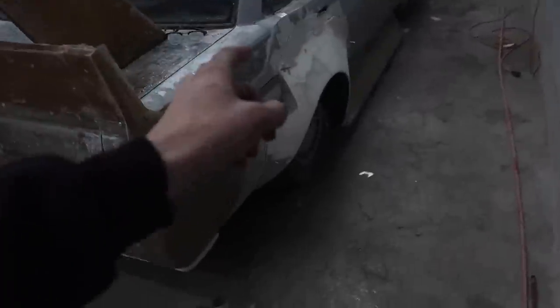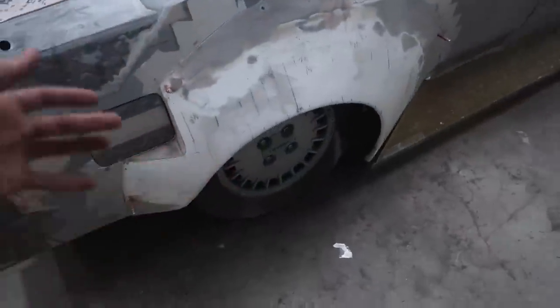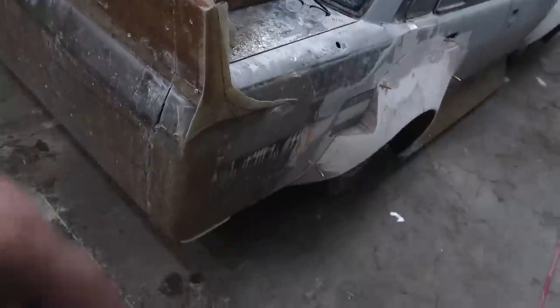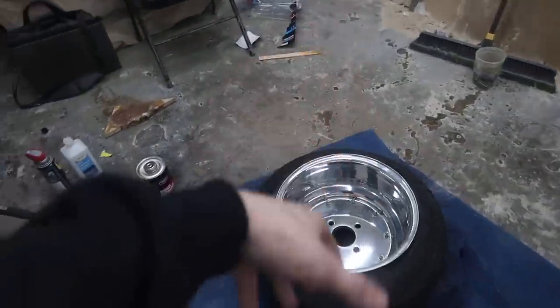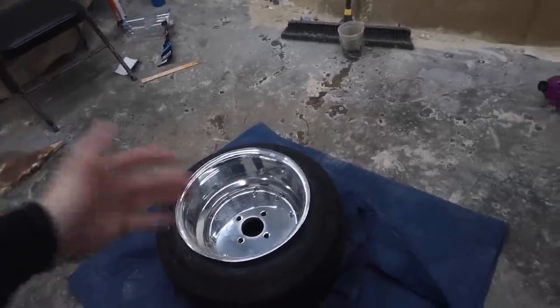We're gonna try and put it on the front and the rear, figure out what kind of spacer we're gonna need. The front's probably gonna be good because I'm gonna have a little bit more clearance because of the stretch. And in the rear, of course, we want better fitment, so we're going to maybe get a bigger spacer than the 1-inch one that we have on there. Or it's actually not on there right now. We have yet to put the new ones on. I took them off so that we can fit the factory wheels on there. But we're gonna figure this out, put the bead sealer on there, fill that back up with air, hope it seals, and then we'll try and test fit it.